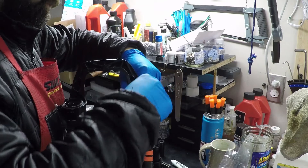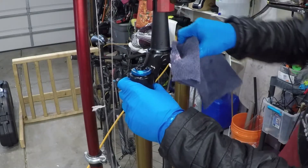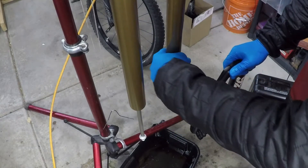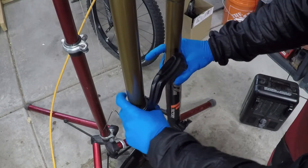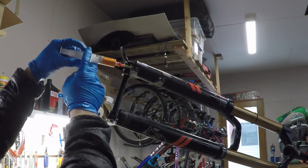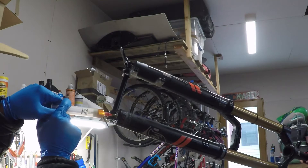Slide the foam rings into their slot — you can see where they go; they'll help lube up the seals. Clean the uppers so there's no smudge, no grease, especially no dirt. Reinstall a fresh o-ring, which is your sag or travel indicator — don't use a zip tie as it scratches up your stanchions. Rock the lowers toward you and then back to help slide them onto the stanchions. Make sure you have the correct oil volumes by referencing ridefox.com and insert the proper oils and volumes into the lowers for your open bath.